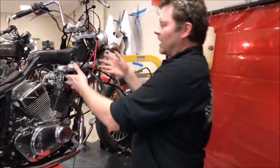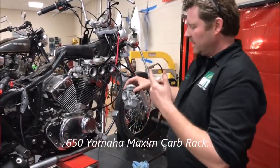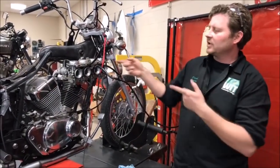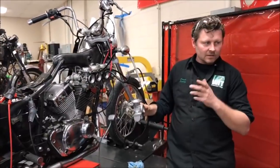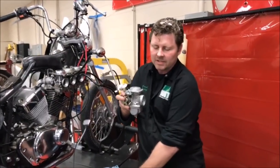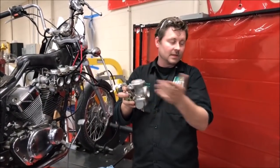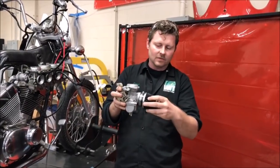We were screwing around trying to figure out what we could do. We went off our carb shelf, grabbed something, and said let's just quit fighting this thing. Sometimes it's a matter of — are you going to put any more time in? Where do you quit? This is just plain not working. You saw what we were doing: instead of taking a jet out and putting a larger or smaller jet, sometimes it's easier to just take away the air and see what happens. If it gets better, we're going in the right direction. If I take away the air and it gets worse, I've got a problem — then I want to add as much air as I can. If I take the filter off, add a bunch of air, and it gets better, then I know I need to make those adjustments. Does that make sense?